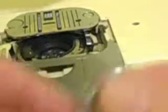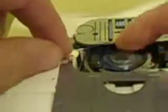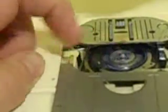Don't get worried. Okay, now let's go ahead and put our needle plate back in. Same way, go to the left and down. Now to put a bobbin back in that already has thread in it, what you do is just lay the bobbin in there. And again, where that number 1 and this little metal arm is, you pull the thread down between that and it comes down and around. You might have to hold the bobbin a little bit with this finger, but you pull the thread clear up and around until it comes up over here to the side, and there's a number 2 right there you line it up with and pull it out to the back.